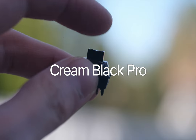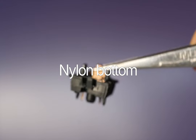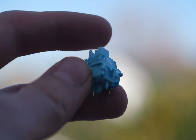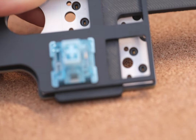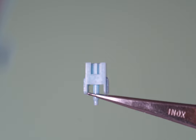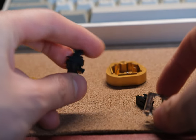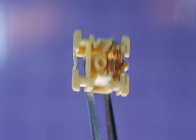The cream yellow, blue, and black switches are all part of Akko's cream lineup. They share the same material blend and travel distance — polycarbonate top, nylon bottom — as well as a shortened 3.3mm travel. They all feel super smooth due to Akko's exceptional factory lubing and all sound pretty bright and clacky. The cream yellows are the loudest of the bunch. The cream blue tactiles are the lightest, with a 55g bottom out lighter than 75% of switches, but they still maintain a satisfying bump. The cream yellows and blacks are linear — yellows are lighter than about half of switches out there, and the blacks are heavier with a 65g bottom out, heavier than 62% of switches. The cream blacks come in at $2.70 per 10, but the blues and yellows are more budget-friendly at $2 per 10. Here are the sound tests for all of them.